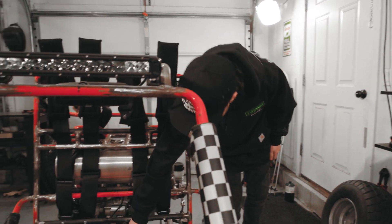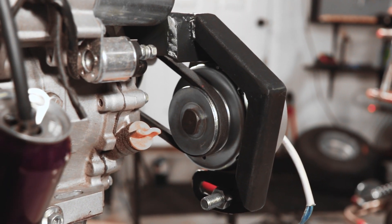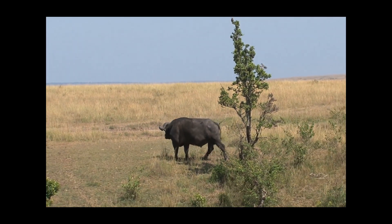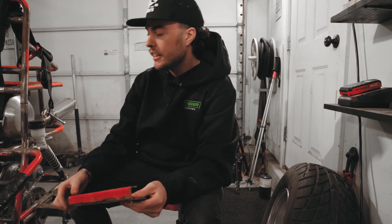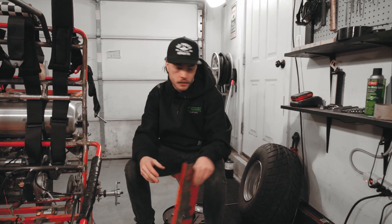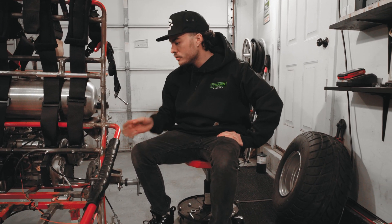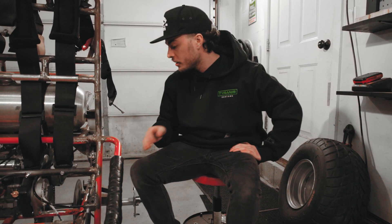So instead, I fabbed up this little bracket with what we had — it's actually part of the old engine plate from this cart. I've been reusing everything, every part of the buffalo. I cut this strip off and used that steel to build the bracket to hold the alternator. Now the alternator is completely supported only from the engine plate from Go Power Sports, allows us to move everything around nicely, and it's installed properly, working, with good belt tension. I'm really happy.